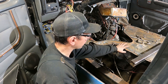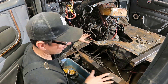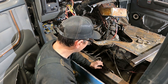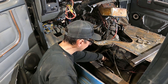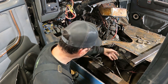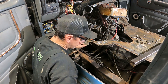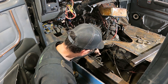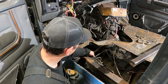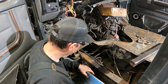I'm going to drill out a couple of spot welds, trim this back, take this piece out, and unbolt the body mount to clean all that up. I'll weld the brace in and patch that last. It looks like water sits on both sides under the footwells by the body mounts and rots it out. Before I weld the floor on, I'm going to unbolt the B&M ratchet shifter that's bolted onto the AOD, and also the emergency brake cable which was hooked up to a power solenoid. The original shifter from the column hooks up to the Z linkage — I have the rod to go back to the transmission and the long rod from the Z linkage up to the column. I can get all the mechanical stuff back in order before I weld the floor on, to make it easier.